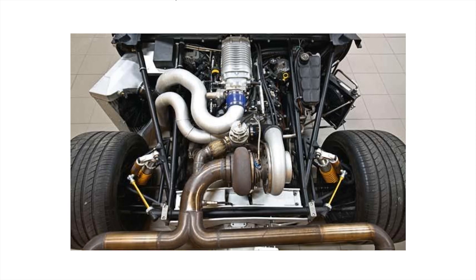So the basic of this powertrain: the Zenvo ST1 uses an LS7, which originally is a naturally aspirated V8, but Zenvo added a turbocharger and a supercharger. This is way different from their new engine, which is twin supercharged — it uses two centrifugal superchargers that act like a turbocharger but are belt-fed instead of exhaust gas fed.